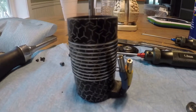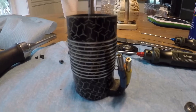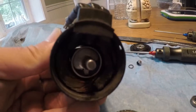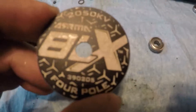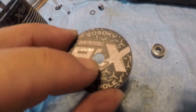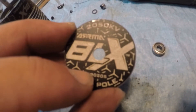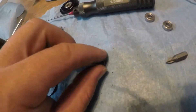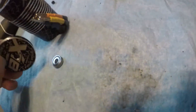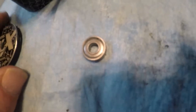Albie is back in action doing some routine maintenance on 6x BLX motors — the BLX 2050kV motor. He drilled a small hole in the back of it, an idea from a previous YouTube video. It's super easy to do: you drill a small hole, and you want a drill bit small enough to go through the ball bearing.